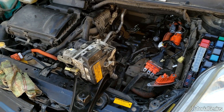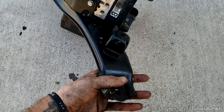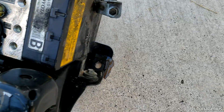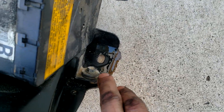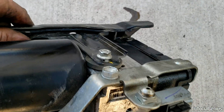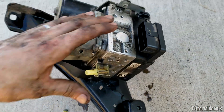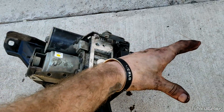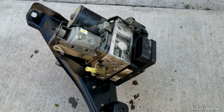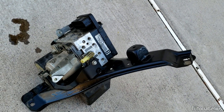And there it is. The reason I chose to remove it on the whole bracket is that normally you can remove the bolt here and the one just down there, but the one on the back is almost impossible to get to. If you could get that, you could lift it up and push it out, but you'd still have to undo the bracket — so that's why I chose this method of removal.